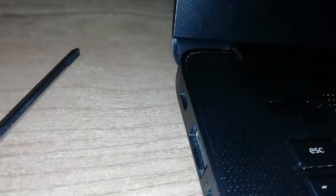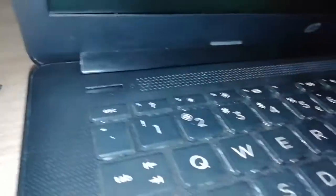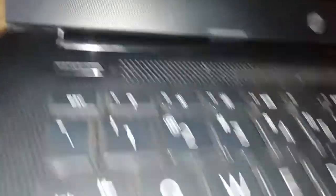Forgetting that, I was facing something I discovered myself. You can see in between the pattern there's debris there. See if I manage to clean that, I'm going to be fine. So it blinks in, blinks out — it's not the screen. There's a video I made where it was the screen. That's why this time I opened the screen. Sometimes you find that the cables which connect to the screen are messed up. But this time it's the button, because I checked the screen nicely — there's nothing to do with the screen.